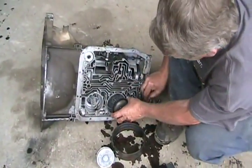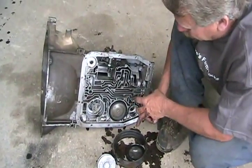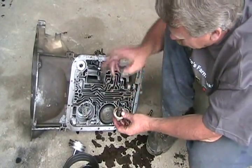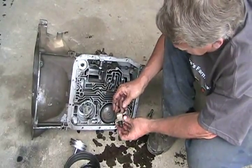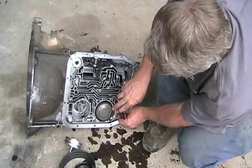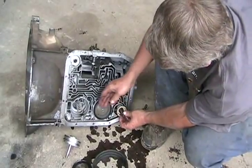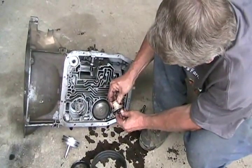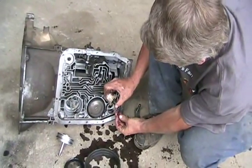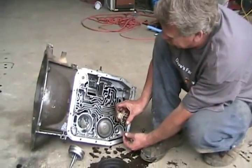When fluid flows in there, it can cause the brake to clamp really quickly and make your transmission jerk — a hard shift. To make smoother shifts, we have a shift dampening plunger. It's just like a little idler piston. When the fluid flows into one of these pistons to actuate one of these brakes, it has this little piston to push against on the same pressurized volume. That smooths out the fluid so it doesn't hit so hard. This little thing dampens it and moves back for a second to reduce the pressure, causing a smooth, gradual, seamless shift in your transmission.